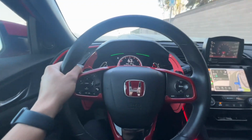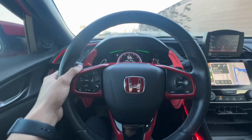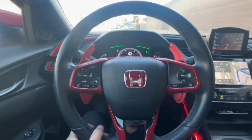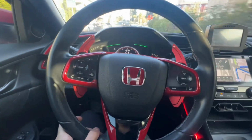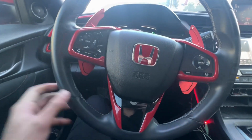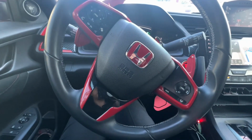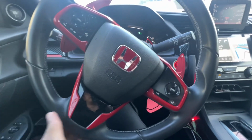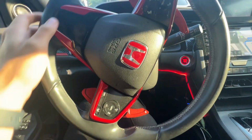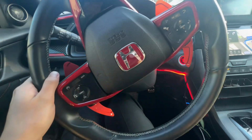And also, like I said, with AMSoil, I was giving it maybe 30% throttle. The power delivery was so smooth. I mean, with the same tune on just the stock CVT fluid, it did not feel this smooth, guys. I am telling you, you can feel it. It's very apparent with just the fluid. And I was expecting my car to have a little bit of slippage earlier. Because previously when I started slipping, I was giving it like 40% throttle. But I was giving it like 35% throttle there, and it felt so smooth, no slippage at all. So it's working, guys.